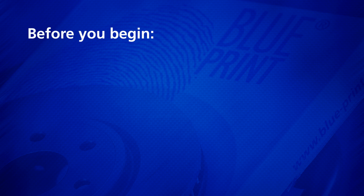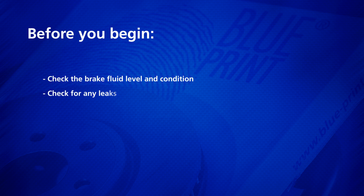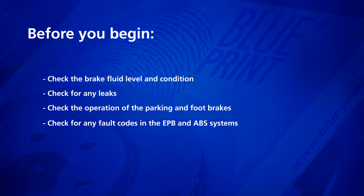Before replacing the pads and discs, carry out a braking system health check. Check the brake fluid level and condition. Check for any leaks. Check the operation of the parking and foot brakes. Check for any fault codes in the EPB and ABS systems.